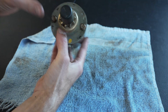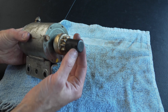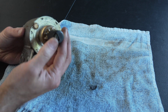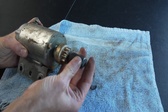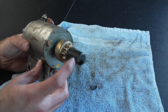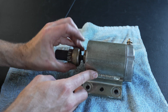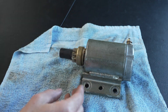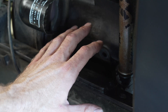I'm a little bit concerned about using this starter because the cap for the spring inside here is broken, and I just broke it even more right there. So I'm sure I could glue that on somehow and protect that a little bit better, but it might not be best to use this when contaminants can get inside that spring area. Hopefully yours will be all good and you can just lube up that spiral spline shaft in there and get your pinion gear moving smoothly on that and put it back in. And of course now is a great time to get this area cleaned up a little bit since the starter's not in the way.